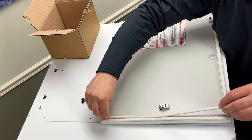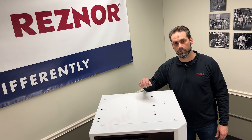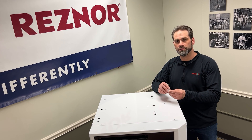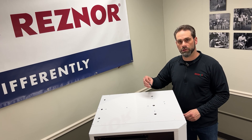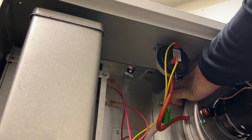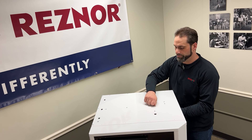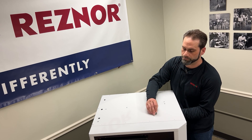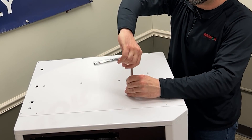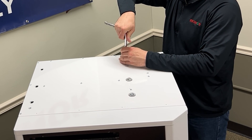On this part of the door we can add two gaskets. If we're not using all thread to hang the heater, then these three holes will need to be plugged up, or any combination. There are bolts and washers that come with the kit so we can go ahead and plug these holes up with those. There's a retaining nut underneath — you might have to push up on it to get it to start to thread, but once it starts it will go in. Just set these in here and crank them down. You don't need to be overly tight, just snug — all we're trying to do is fill those holes.